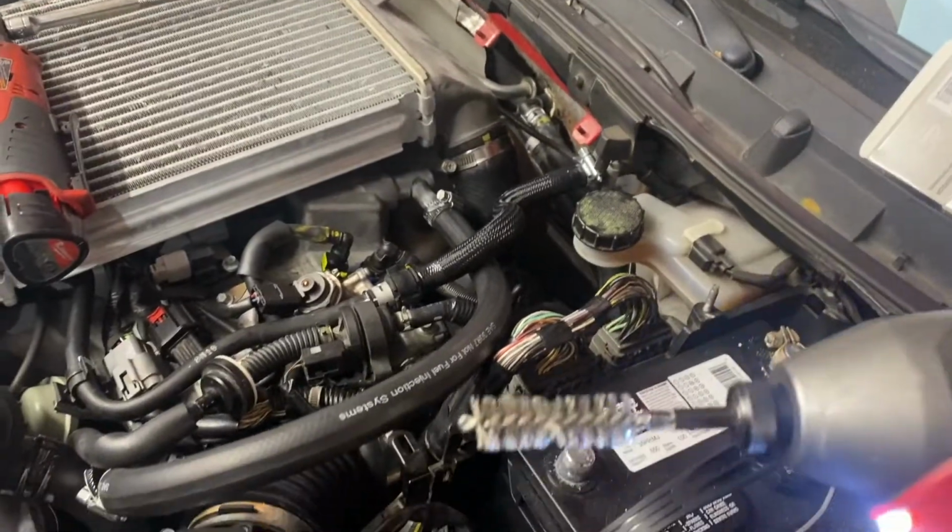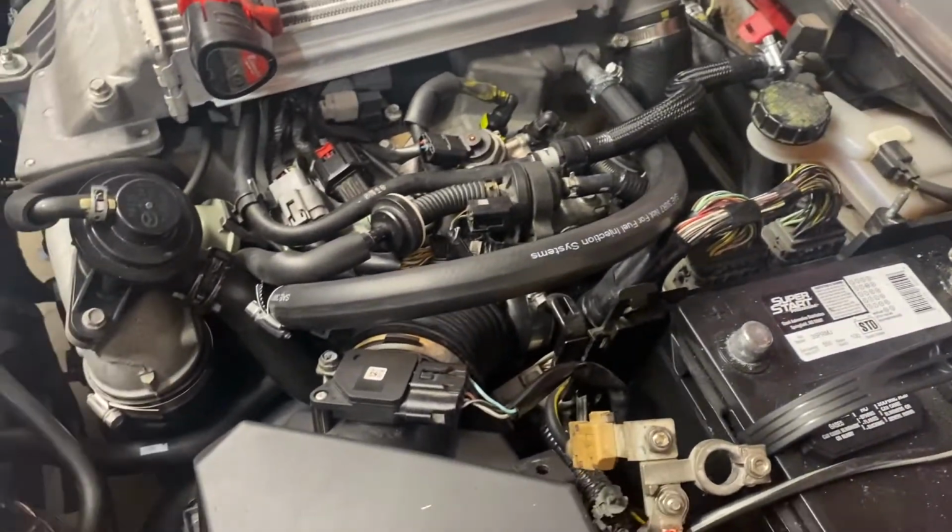All right, I'm sweating like freaking bullets. It's hot. I got the intercooler on, the air box. I got coolant in it. All the fluids. I just put on the battery. It wasn't getting power, but I noticed that it had been sitting outside. So the battery terminals were corroded. I cleaned them up here, and this one too, especially. But I just used this for basically battery terminal cleaning.